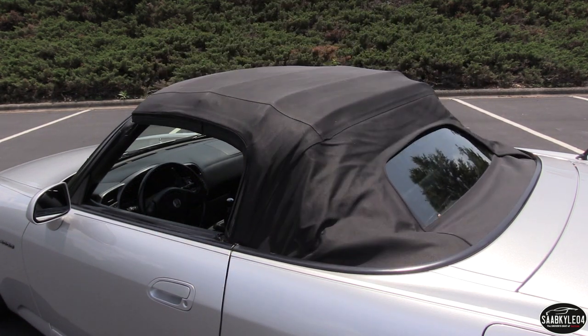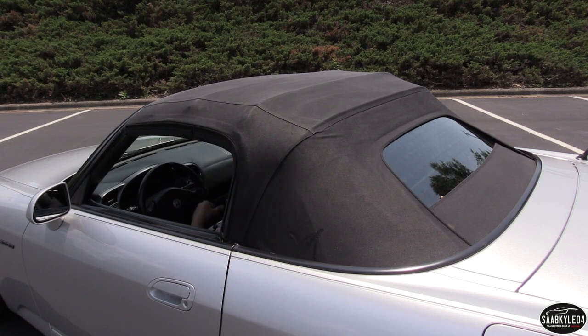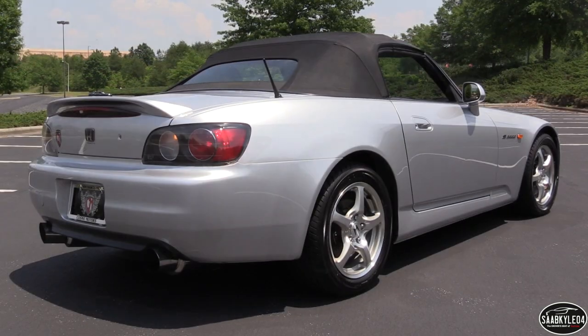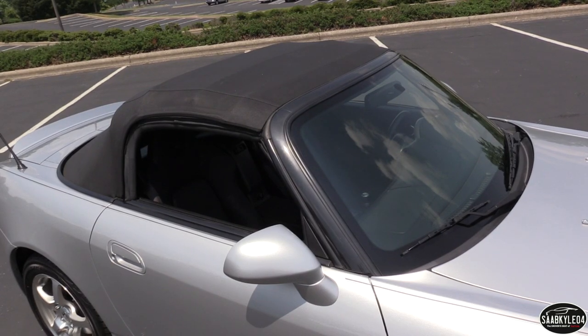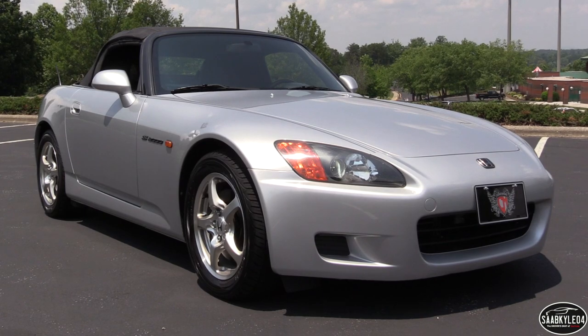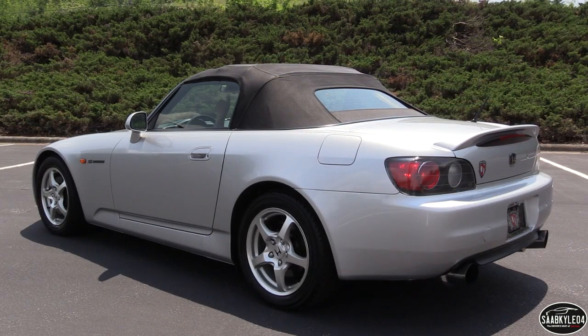Aside from the obvious handling benefits, this also creates an inherently strong structure that resists deformation in the event of an accident. Further facilitating energy absorption is high-strength tensile steel, which was used for the front and rear side members of the chassis. In the event of a rollover, the windshield surround is strengthened by a tubular brace, while fully trimmed roll hoops reside behind the seats, are internally reinforced as well, and securely anchored to the X-bone frame.